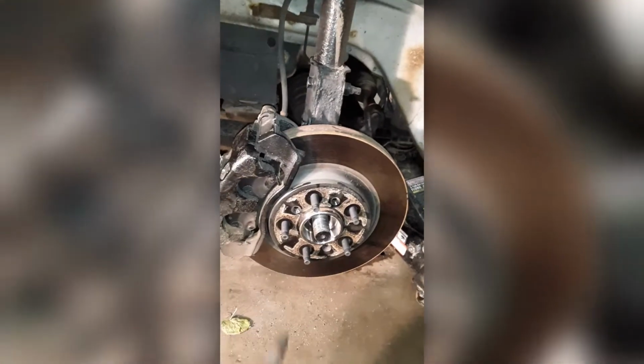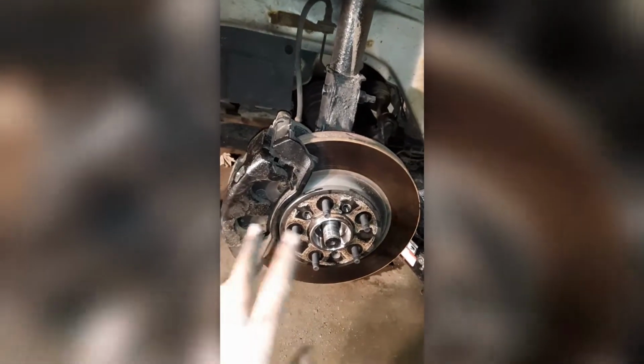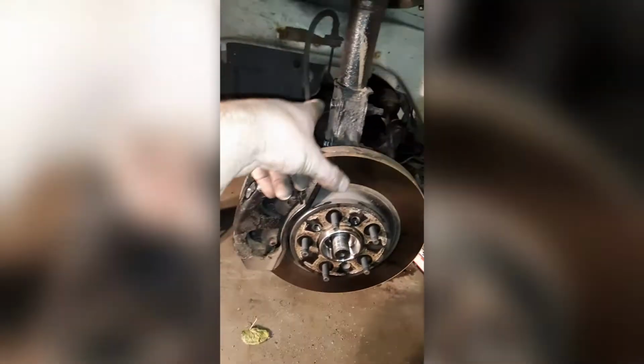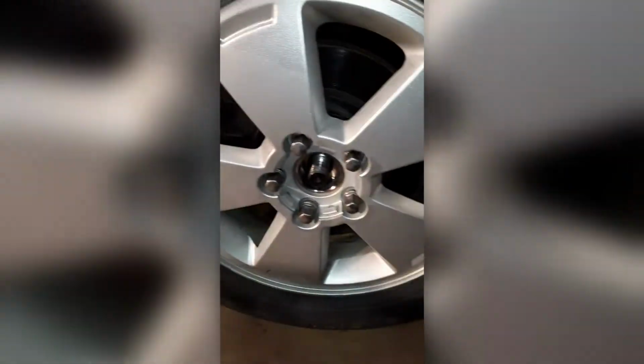And when you get those bolts put back on, go ahead and put your rim back on. Then start threading your lug nuts on there. And then just thread them so they're all the way down, but you don't want to try and tighten it while it's up in the air, because it'll move the CV shaft and everything. You don't want that going on. I just went ahead and removed the center cap as well, because remember, we still have to put the axle socket back in there.